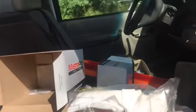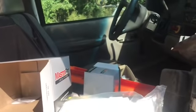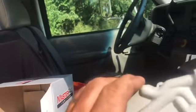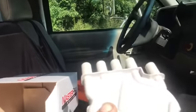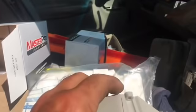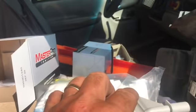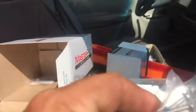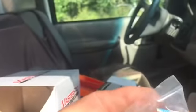So he's claiming that the screws for the distributor cap, which what he's saying holds true for a lot of automotive parts, when it comes to the distributor cap, have a screw in there and it's L-shaped and it's spring-loaded, but not on this. These are Torx head and they're about 1 inch long. There's no L shape to them.